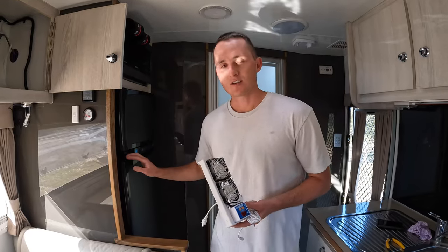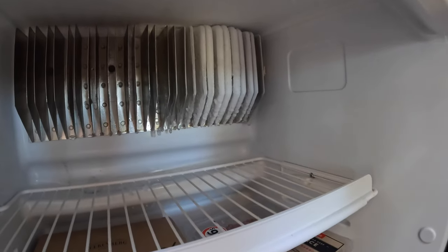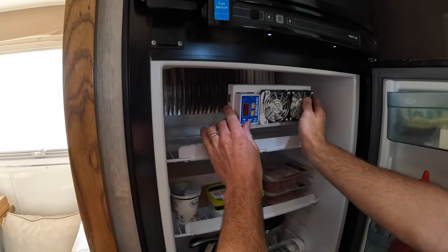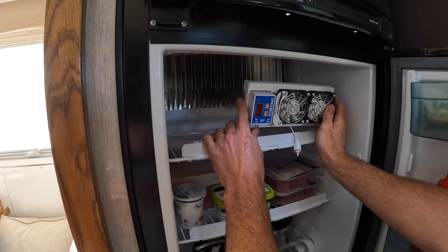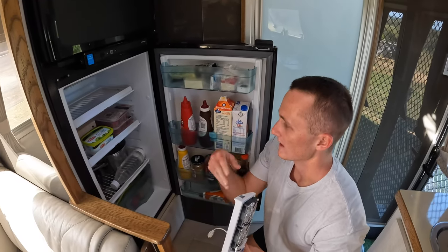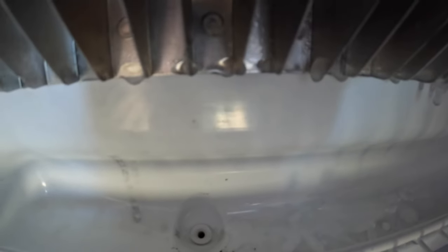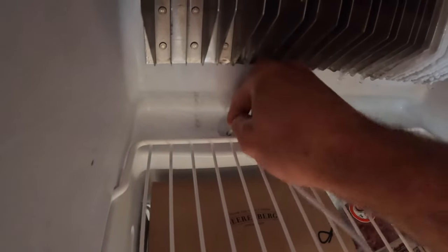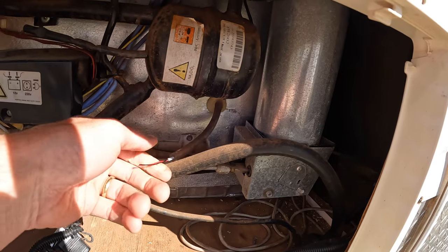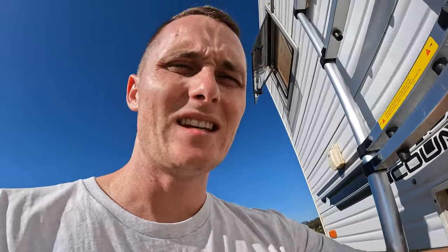You can see inside there's actually a fair amount of ice built up, so I'm going to locate these fans mainly on the right-hand side of the fins, so rather than icing up in one spot, that cool air gets circulated through the fridge cooling everything down. A lot of these fridges have a drain hole - I have one up the back here. All I need to do is take the cable up and push it through the drain hole, then it comes out on the outside of the van so we can wire it into our control panel on the external vent.